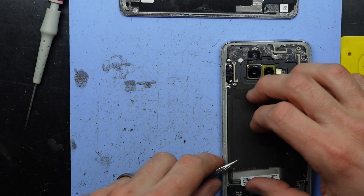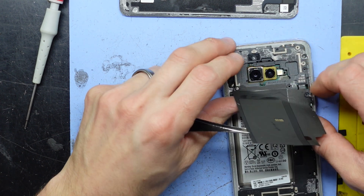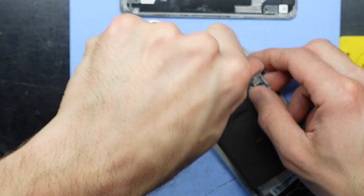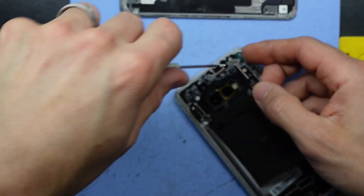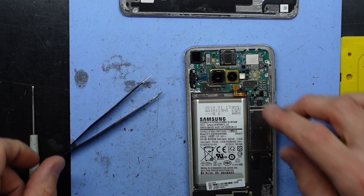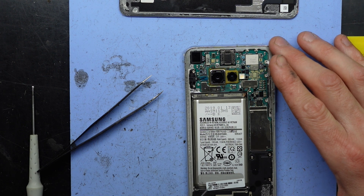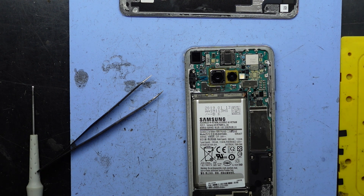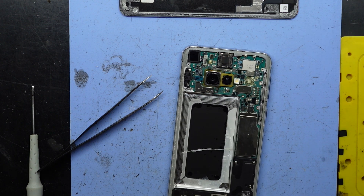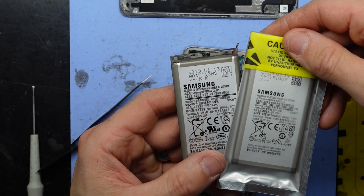A pair of tweezers and lift this up. One screw hidden — there we go. 2019. So we have one rather tired battery. I'm just going to drip some isopropyl alcohol down the edges to soften the adhesive, and I should be able to hopefully just pry that out as one piece. Like so. One very old battery and one much younger battery.